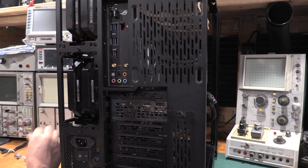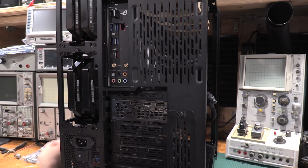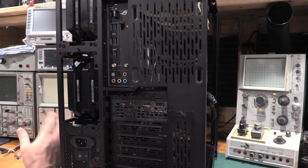On a RAID 10 array with the black hard drives, I tend to realistically, not benchmarks, just realistically, see about 75% the performance of an SSD. So I get 75% the speed of a good SSD, but I get 8 terabytes, and it's redundant to a drive failure. So RAID's a wonderful thing. All my computers going forward will have it. For my home desktops that are my primary use ones, here, there's three of them.